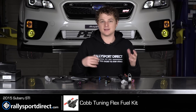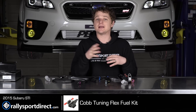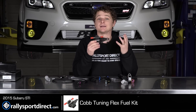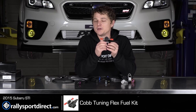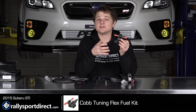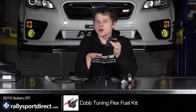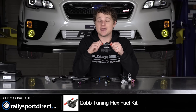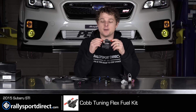The whole point of this kit is so that you can run E85 in your car and you don't have to worry about what if you get E95 or E70. This sensor will pick up the difference and provide the right amount of information for the ECU to give you the proper tune. Also, Cobb will be coming out with some plug and play maps that you can download off their website. So if you're running this kit with the specified components — such as injector, fuel pump, and turbo combinations — everything will be plug and play. You don't have to go get a custom tune; you can literally just download it off Cobb's website and install it on your ECU and you should be good to go. This is a phenomenal kit and we are so excited for this.